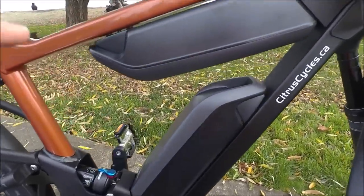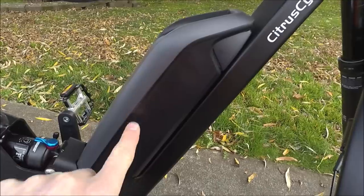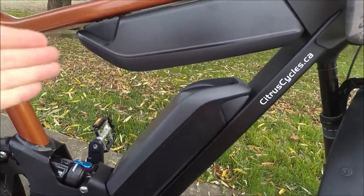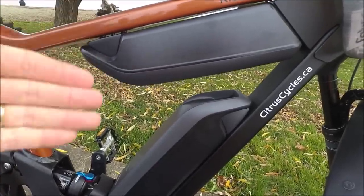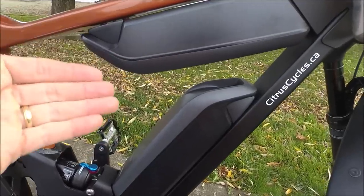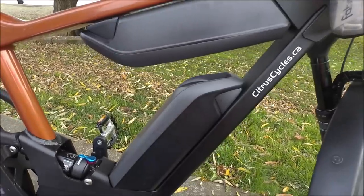That's because Bosch designed the system to draw 5% from one battery and then switch and draw 5% from the other battery. A battery, when continuously discharged, is under higher stress and that means a shorter lifespan. When a battery is discharged 5% and then rests and then is discharged again, that's actually lower stress on the battery, and so that helps prolong its lifespan.